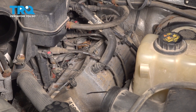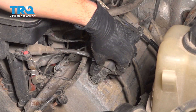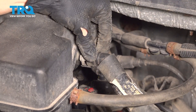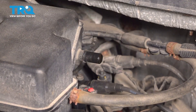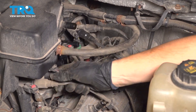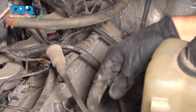Let's start removing items that run across the valve cover. This breather tube being one of them — press on the gray tab and twist it, then pull it up and take it off the PCV valve. I'm going to remove it off the top as well; the clip is just on the back side. Now let's unplug and unclip all of the spark plug wires. We can leave the retainers here, but if we open them up, that will release the wires.